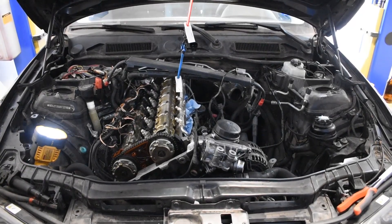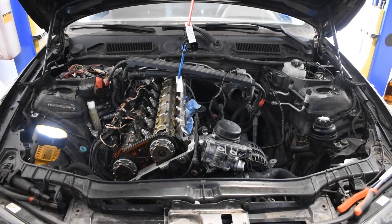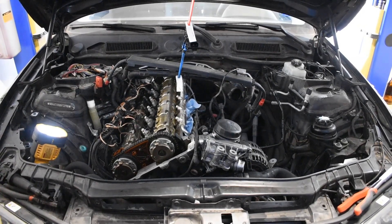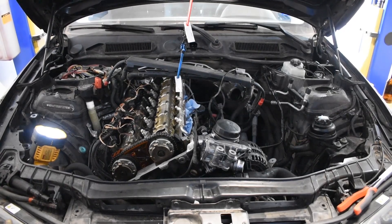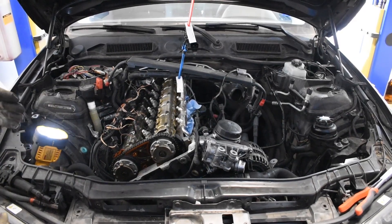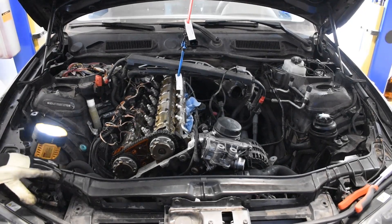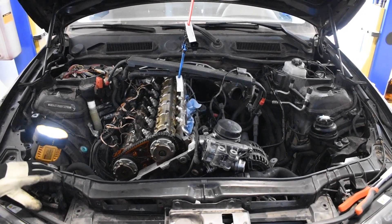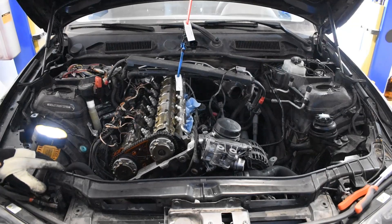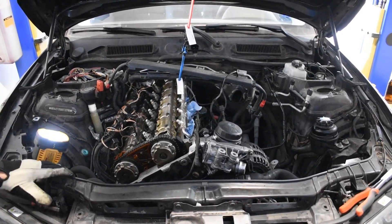A couple other things that we're going to do while we're here: the ignition coils and the spark plugs. One ignition coil had a lot of oil on it. The coils didn't look too bad, but I can't remember the last time I replaced those. And we're going to want to go ahead and switch from whatever spark plugs I have in here — I can't remember if it's the OEM ones or the one-step colders — but since we're running single turbo and shooting for pretty high power levels, we're going to want to go ahead and switch to the two-step colder plugs. So we're just going to replace the ignition coils while we're at it.